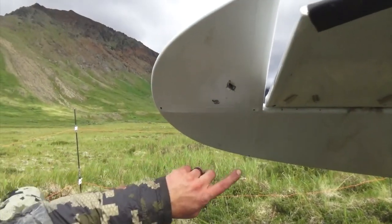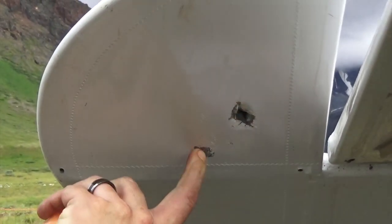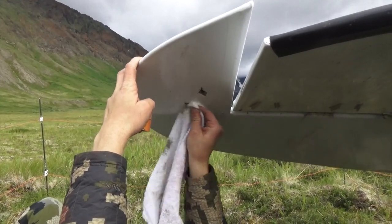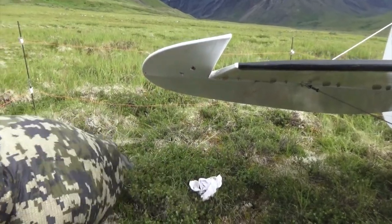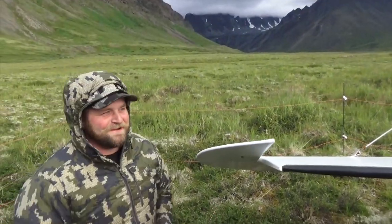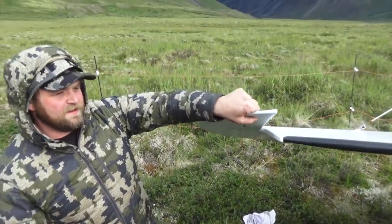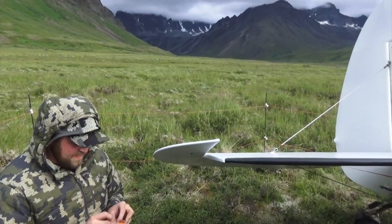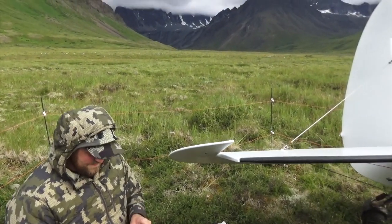Look under here — it's supposed to look like this on the quarter panel, and it looks like this instead. I'm going to put a little av-gas on it. This is a certified bush repair job — clear Gorilla Tape is money, or duct tape. A Super Cub is basically bed sheets wrapped around a steel tubing structure of Chrome Moly 4130 steel. This tape will last until I can get back and do a real patch, or realistically until after hunting season — be a good winter project.